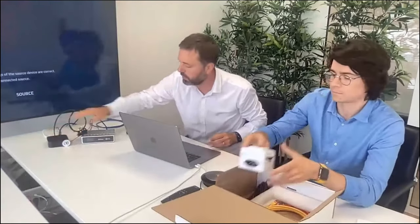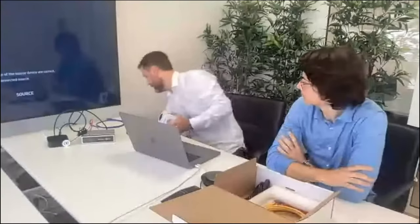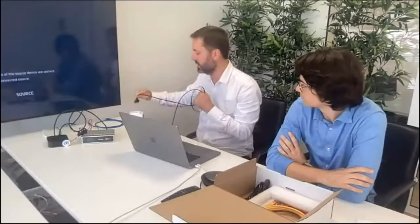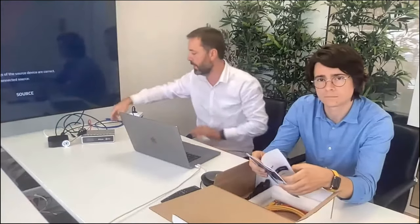Also built into the WitBox is a Bluetooth controller to control, for example, Android TV set-top boxes, as well as a Zigbee RF4CE controller to control, for example, Comcast X1 boxes. Ultimately, I need to power up the Apple TV using the provided power controller, which allows you to power cycle the device under test remotely. Because these are consumer-grade devices, it's normal when used 24/7 that they will crash at some point. Being able to manage the power cycle is therefore essential for remote testing and automation.